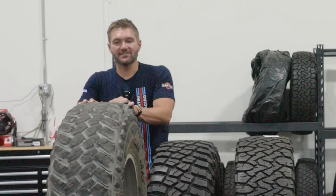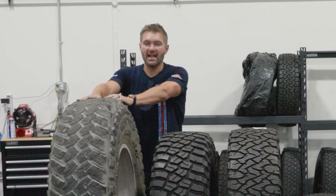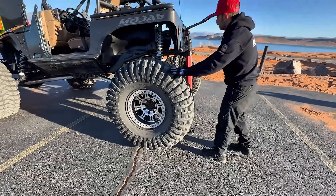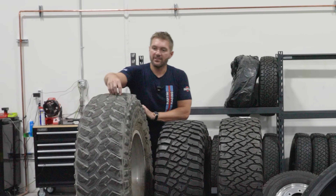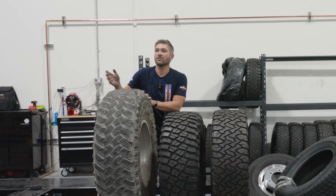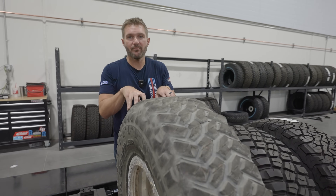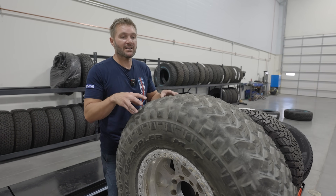Now we get to what I call another novelty tire. This I believe is a 42-inch tire — look at the sheer size compared to a 315, one of the biggest tires we run on a Sprinter. This is an absolutely massive tire and it weighs so much I can't even lift it. It's off a rock crawler or rock buggy and it's definitely seen better days — totally shot. The lugs are all torn to pieces because this tire is a very soft compound for grip. You're not really expected to drive it on the road; it would make so much noise. If you've ever heard one of those trucks drive by with that loud whirring noise, that's typically tire noise — this would have a tremendous amount of it. Typically a vehicle like this would be towed to the trail.